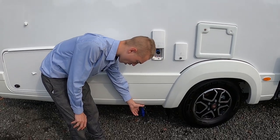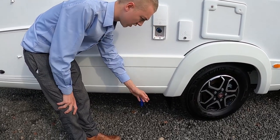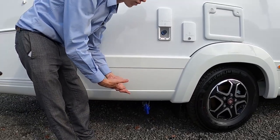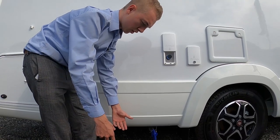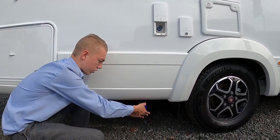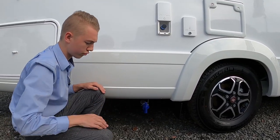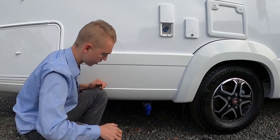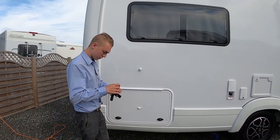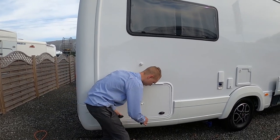On the skirt here you've got your fresh water drain tap. If you've got a full tank, you won't want to travel with it as it uses more diesel. So open this up on the way out of a site over a grid or gully and drain your water off. The back of the vehicle opens with your round key — the same one you use for your toilet and all your external lockers.